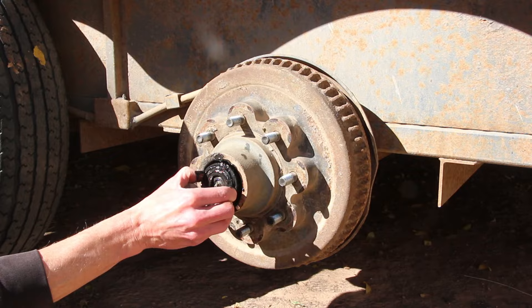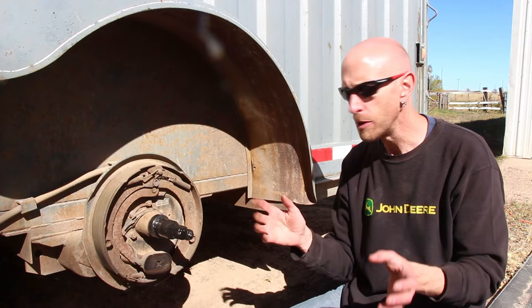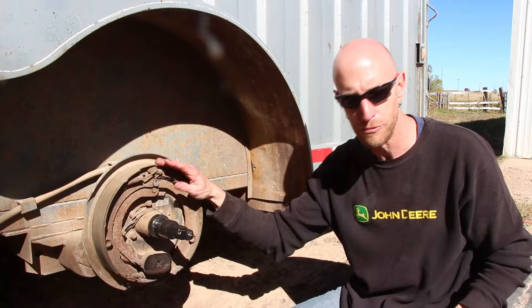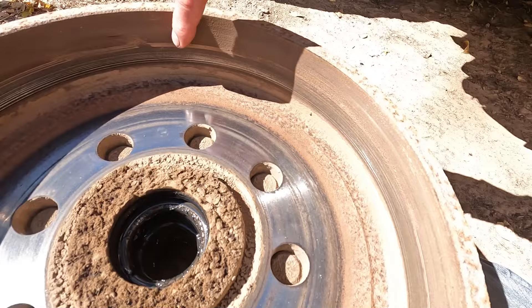I'm gonna pull out this washer — this one has the bearing stuck to the back, which is okay. And now the drum will just pull right off. With the hub off, I'm taking a quick look and I can see dirt coming off the pads on my fingers. They're not shined up, which tells me these things really aren't functioning. It could be because the unit malfunctioned or maybe it just needs adjusted, but it'll work much better once we replace everything. Looking inside the drum, the surface isn't shiny either — really these things weren't doing a whole lot of anything.